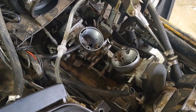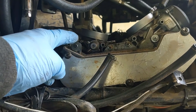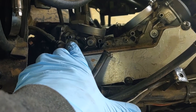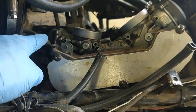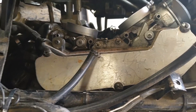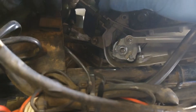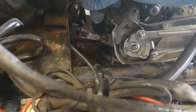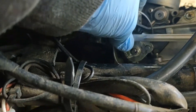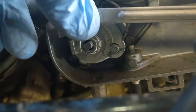Got the carburetors up now. I'm going to pull the throttle cable off. What you do is take these two screws out - one here and one here - and loosen this clamp just a little bit. You'll have to get the cable off with the little cam in there. I'll cut the camera back on once I get this cover off and show you what's on the inside. With the cover off, loosen this little pinch nut up a little bit and it'll let your throttle cable slide out. Then rotate your throttle around a little bit until you get that barrel on the end of the cable out.